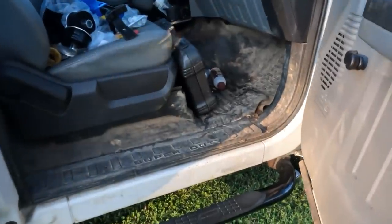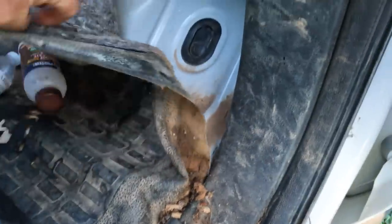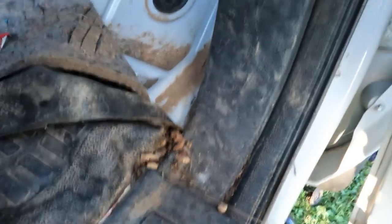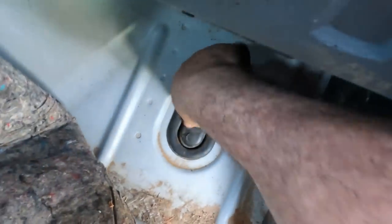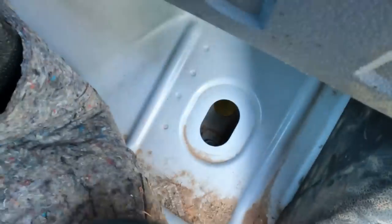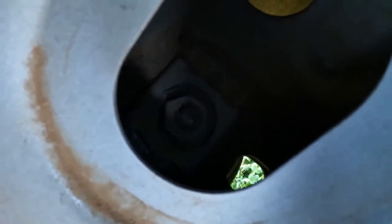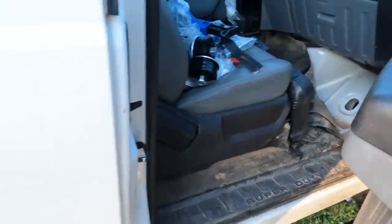Then I'm gonna go over to the other side and replace those, and I'm gonna deal with the broken bolt last. There is an access port for that cage nut — let me see if I can get in there and show you what that looks like. It has this little cover, and down in there is the cage nut. It's like a square that is tack welded in. You can still see the bolt head — that bolt must have been sticking out far.